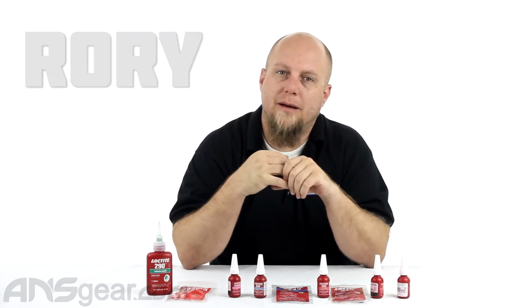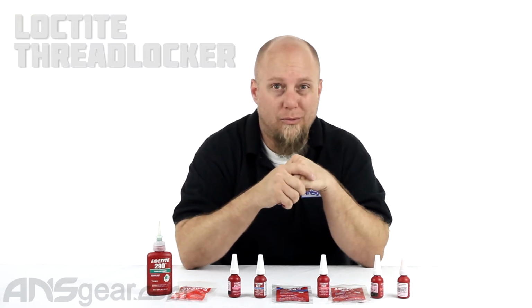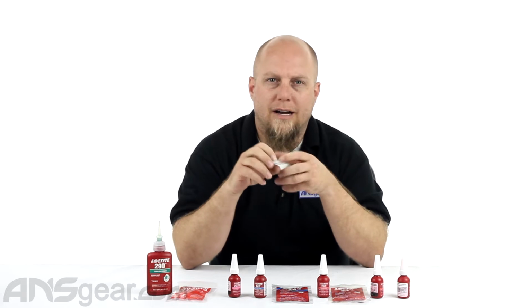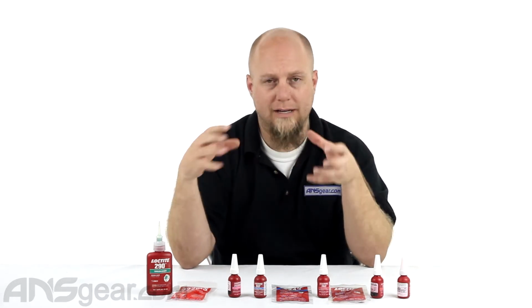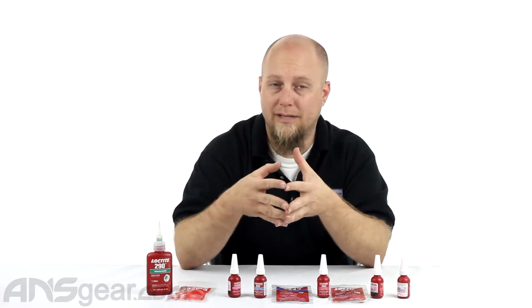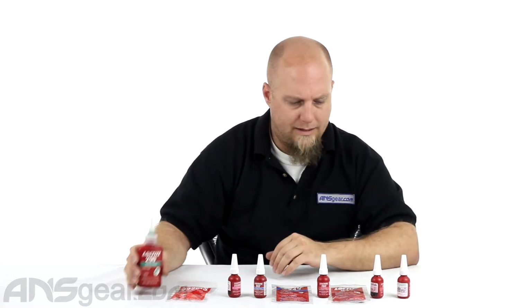We're going to take a look at some Loctite products today. These are all the Loctite versions that we offer through the website. If you're doing any kind of air fittings for your paintball guns, screwing in macro fittings, or you want to put set screws in that you don't want to vibrate loose, but you don't want to permanently lock them down, there's a couple different levels or versions of Loctite that you could possibly use to give you the ability to still adjust but not lose screws, or to set things down where you would have to heat them up to take them out.